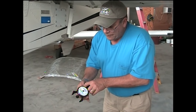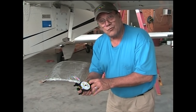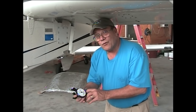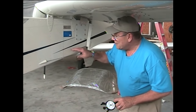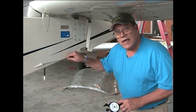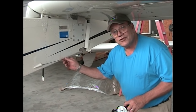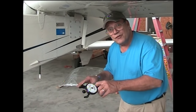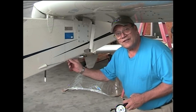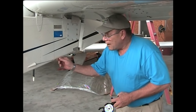So if you get one, or if you borrow it from somebody, you might want to just give it a quick check on some known weight to make sure that it's within tolerance. Because right tension cables are wonderful; wrong tension cables — what happened on this plane is that when they reassembled the airplane, the cables were so tight he couldn't get the rudder pedals to move. They would move with a lot of force. As soon as we released some of the pressure on the cables, everything moved real smoothly. So the lesson of the day is: put the cable tension where it's supposed to be, and you'll have free, full, smooth controls at all times. I hope it helps.